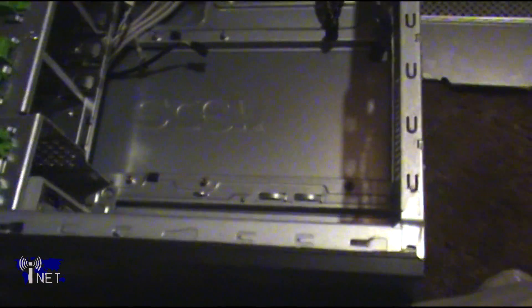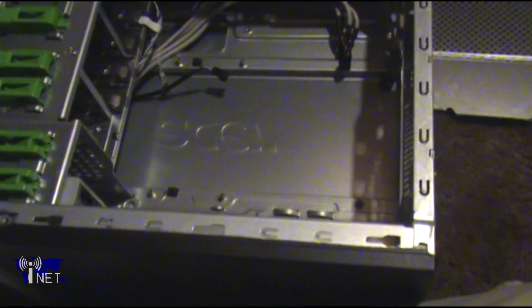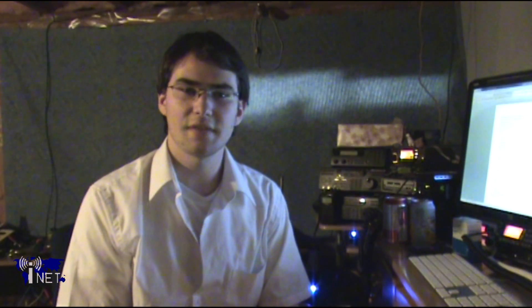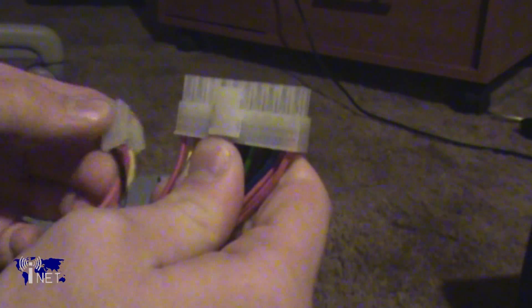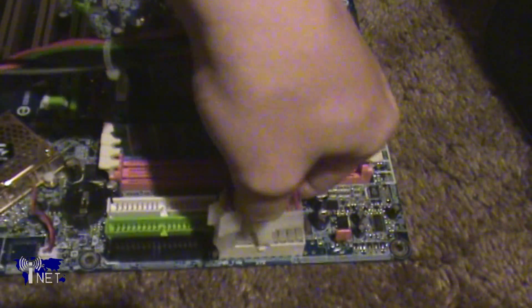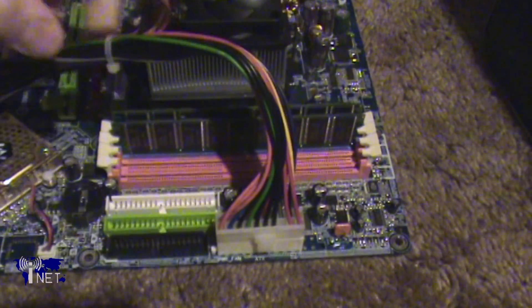However, if it doesn't lift out, make sure you look for any latches or levers that are holding the unit in place. Now it's a simple matter of unboxing the new power supply and inserting it into the old case. Screw in the screws and then just go through and reconnect all of your devices. It should be noted that the last four pins on the main motherboard connector can be removed on most power supplies, so that the power supply can be compatible with just about any motherboard.